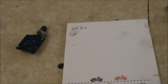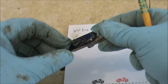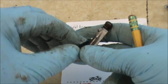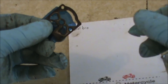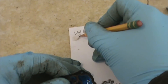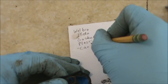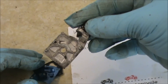Because I don't do this every day, I like to take some notes. On the Walbro side of the carburetor — it says Walbro there — the order is going to be the metal plate that says Walbro, then a rubber gasket material, then the gasket, and then the blue membrane. So on the Walbro side it goes: plate, gasket, plastic, then the carb. I'll remember that order when I rebuild this, and you can see it needs to be cleaned a little bit.